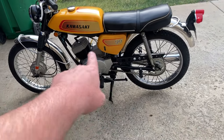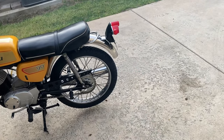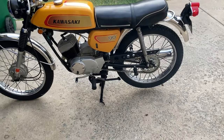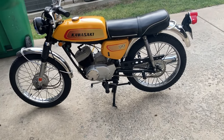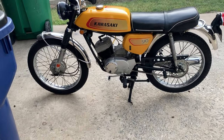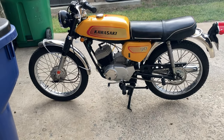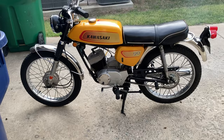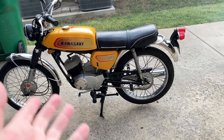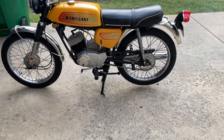To protect the engine, I have the oil injection turned way up, so it smokes a lot more than it typically would — but I'm okay with that. I haven't fouled a plug yet. It's got one of those E3 plugs in there, and those things do actually make a difference for those questioning them. I'm not sure I'd use it in my fuel injected stuff, but definitely in a small two-stroke engine — 100% the E3 is the way to go. It's been perfect for this bike.